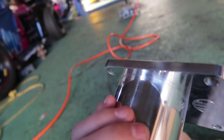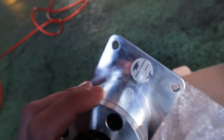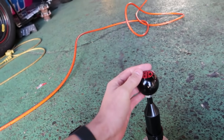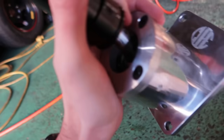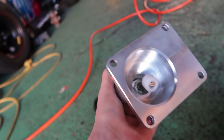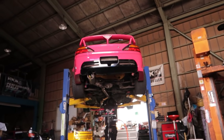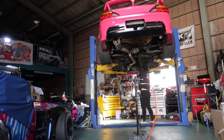This thing is incredible. I love billet pieces and this is just amazing — well machined with Cube's logo on there. This pretty much comes out of the box pre-assembled like this, minus the shaft and shift knob. It comes all pre-lubed and greased up, so you don't have to pull anything apart. It comes with a brand new Delrin bushing which will take some slop out of your old worn factory one. One thing to note is you will have to jack up the car or put it on a lift to get to those bolts on top of the transmission — it's going to be a bit of a pain, but the results will be worth it.